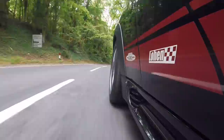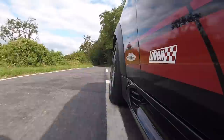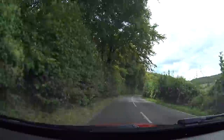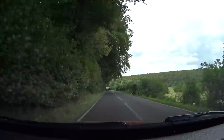Some of the changes are like a sledgehammer to crack a nut - the power is obvious. Then you start getting slightly more subtle changes like the diff and the clutch - for me I can feel them straight away. Mrs Petrol Pen says she can't feel any difference at all. The clutch pedal spring - I was a bit worried it might be a bit stiff, but it really isn't. The gear selector gates took a little while to bed in after the clutch had been done, but then it was back to how it was before. Putting Powerflex bushes in the car has made it very, very direct - it's taken a lot of the slack out of the steering. All of those parts added together make this car on a road like this just the perfect B-road weapon.